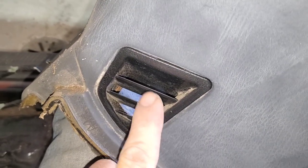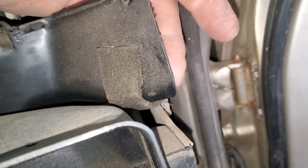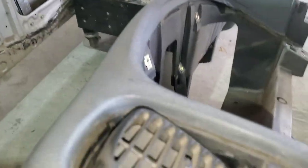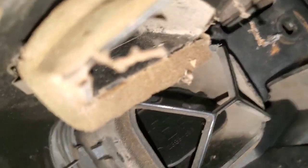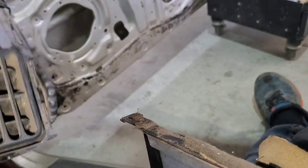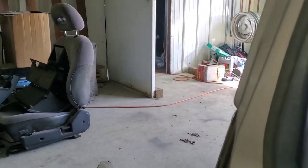When you put this dash back in, the pieces on the end will have to be pulled out because they have to slide back down into the slot — those are the defrost for mirror and defog. Now the dash is out, I can flip it over and push that vent out from the inside. Of course it fell out after me prying on it forever — couldn't get it out and then it just falls out now.